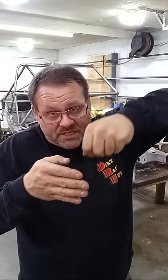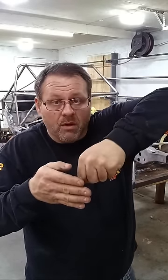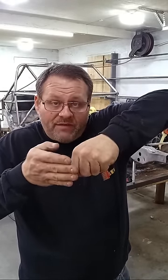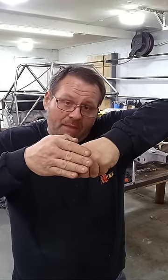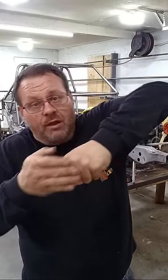So basically what that looks like is that as that car compresses down into that right front and rolls over on it, you've got to have this camber curve that curves the tire back in. That way, as the car rolls over, it doesn't make the tire lean out. All right. So what you really care about is, how much is my car rolling this way versus just doing this and sitting down?